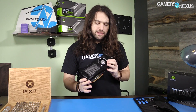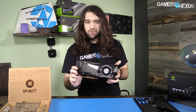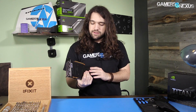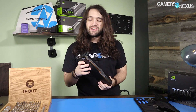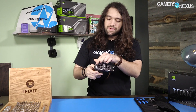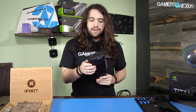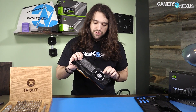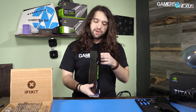Let's get started. First of all, this is a reference design — there are only reference designs for these Titan XP cards, as far as we know right now. Things are pretty standard from the outside; there's a bit of red tinting on the PCB. No DVI, so that simplifies the teardown a bit — we won't need to use the three-point-something millimeter hex to remove that. The rest is going to be 1.5 and 2 millimeter tools: Allen keys, Phillips heads, stuff like that.